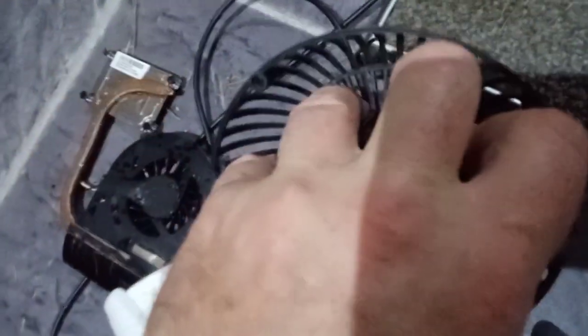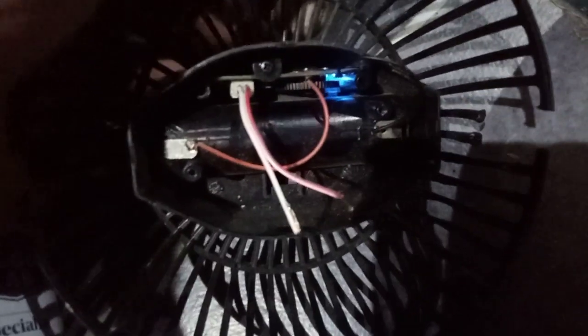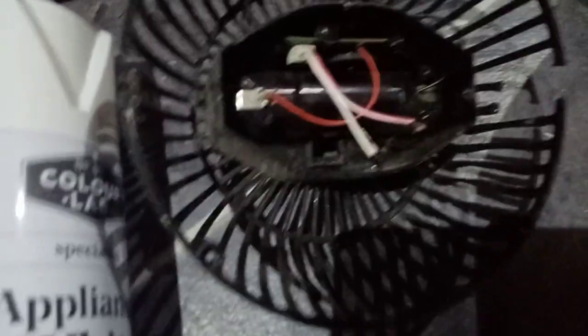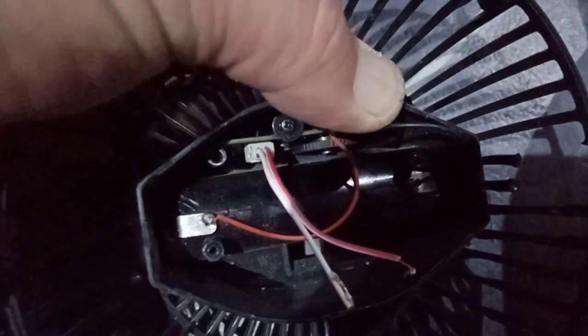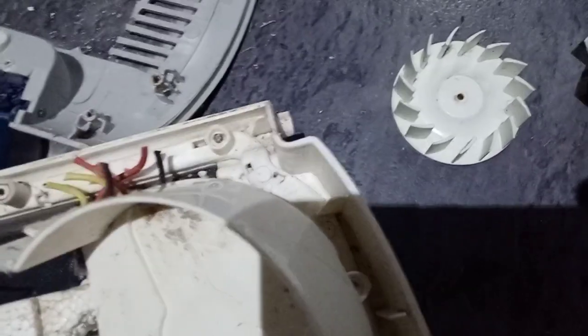Because we're using one of these old external fans with speed control, we'll have control over the fan speed — which also means control over how much power we're using. Strip down the old battery pack unit; we're going to cut all that out, mod it, and put it inside the chilli bin so we can turn it off when not needed instead of wasting power. Then get some paste and repaste the cooling plate.